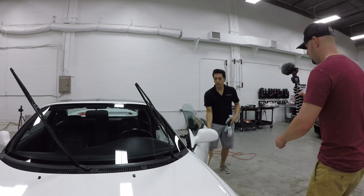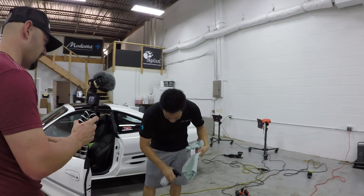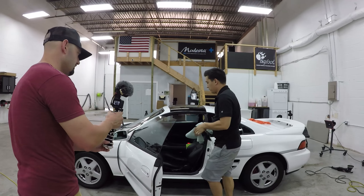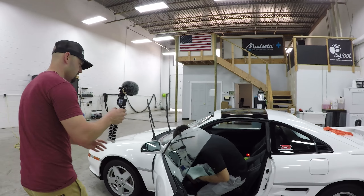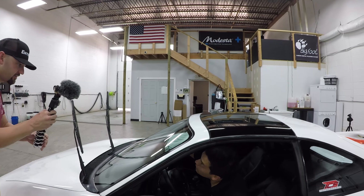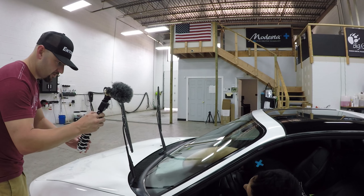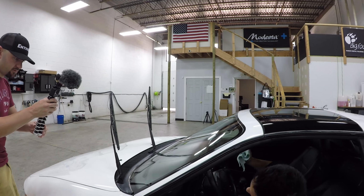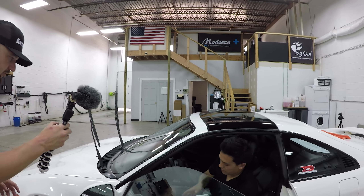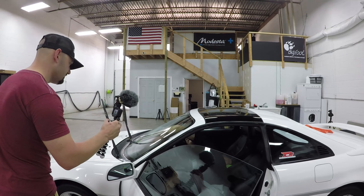As long as you do it right, you can see obviously what you had on the inside. Now on the inside you're going to work in a different direction. The reason you want to do that is you're going to be limited sometimes when you get into tight areas, but you're going to be able to see where your mistakes are happening. Make sure you spray directly on the towel — never spray on the glass. I would never recommend it if you have sensitive dashes or products things like that.